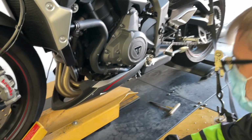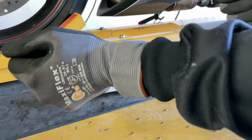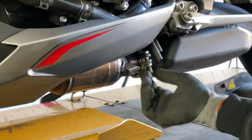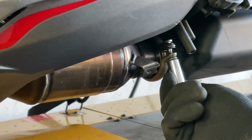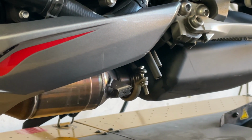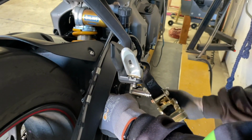Yeah, so the stock exhaust has a beauty cover on the left-hand side. It needs to be removed. There's a locating tab on the front. You need to slide the beauty cover forward to release it. Now it'll give you access to the clamp, which is going to be the forward part of the rear part of the exhaust we want to remove. That is, in fact, a 10 millimeter. So the exhaust is hung on a pin that is in a rubber dampener on this side. So the only way the exhaust is going to come off is going to be to move it rearward. Our 12 millimeter.